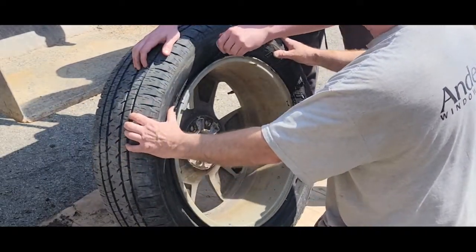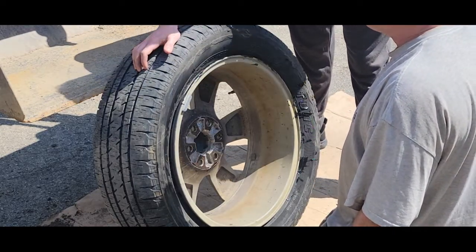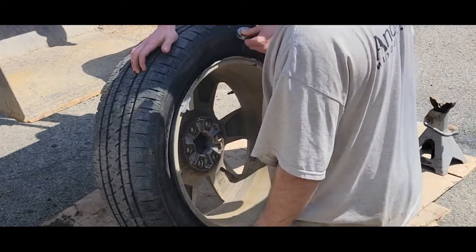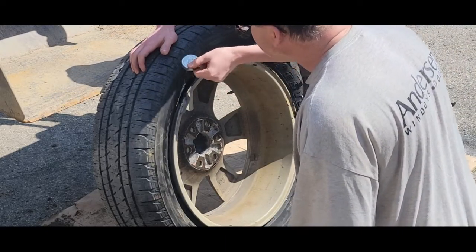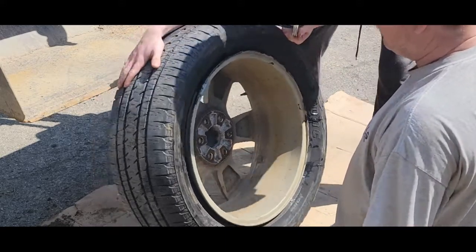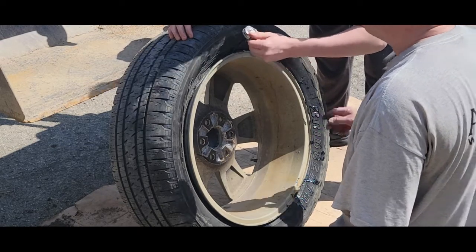We're almost done with this project. I'm excited — I just don't want to put air in this thing every couple days. Every time I take him bowling I say I better check that tire and sure enough it's down. I never have tires that go down normally because I buy tires when needed. Brakes, tires, bearings, exhaust — I gotta have that stuff fixed. Dawson's doing pretty good, it looks good — smooch it right in there. If I had this off the rim I would coat the whole rim with sealer and use tire lube when installing it.